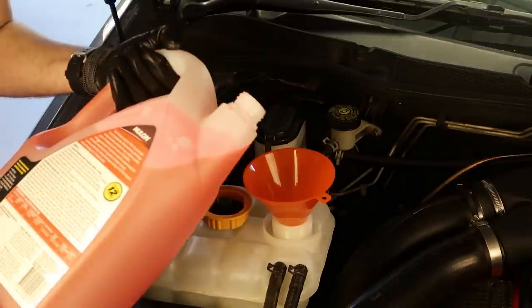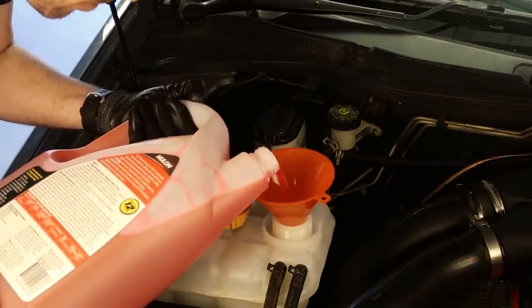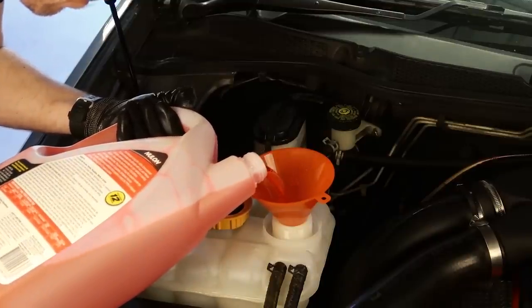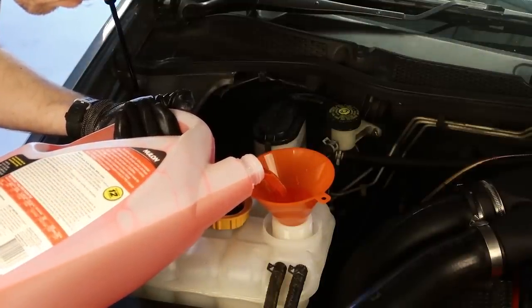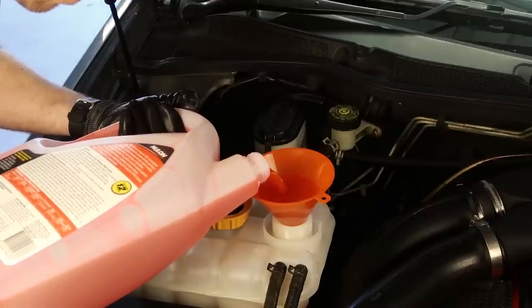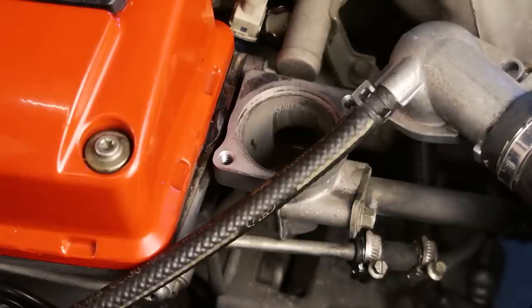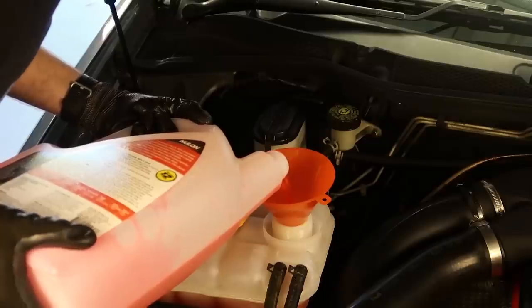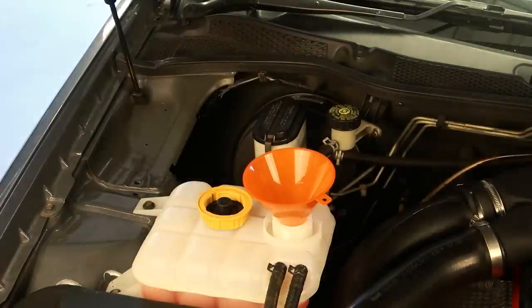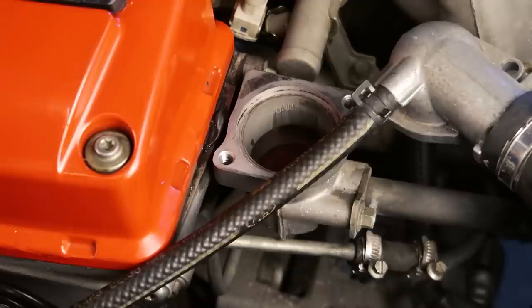With the tank installed, I'm going to start pouring in the new coolant. This is a concentrate which you need to install in a 50-50 mix — meaning half coolant, half demineralised water. According to a quick search, the XR6 Turbo engine should take around 8 litres to fill the entire cooling system. So I'm going to start by pouring in 4 litres of the coolant concentrate. Because I haven't reinstalled the thermostat yet, I'm keeping a close eye on the coolant level to make sure it doesn't start leaking out of the open housing. I was able to get all 4 litres in without seeing coolant arriving at the thermostat area, so I'm going to start pouring in the demineralised water until the coolant approaches the level I want.